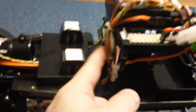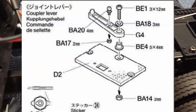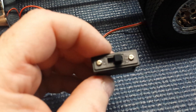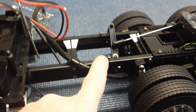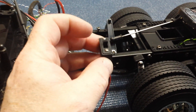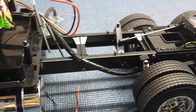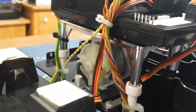I decided to do a little modification. I ran the wire from the rumble motor down underneath the truck, cut it, and I'm installing a switch on it. The plate that has your disconnect lever actually has a switch mount built in, so I can mount the switch directly to it. I'm painting that plate blue to match the truck. The switch will sit below the deck and the wires will route up into the main wiring harness from the rear, so I can disconnect the rumble motor when I don't want the truck shaking the entire time I'm driving.